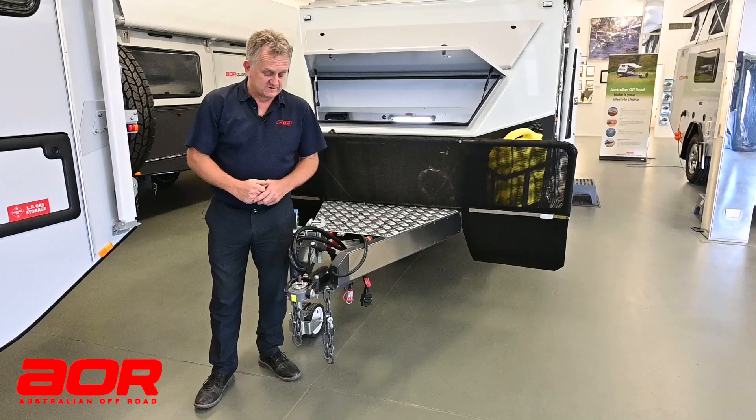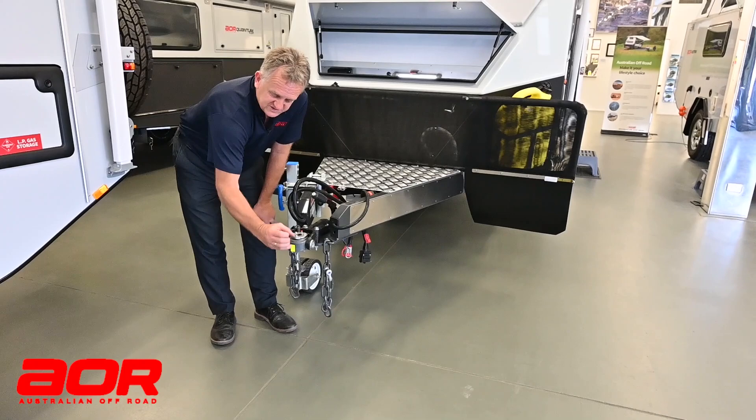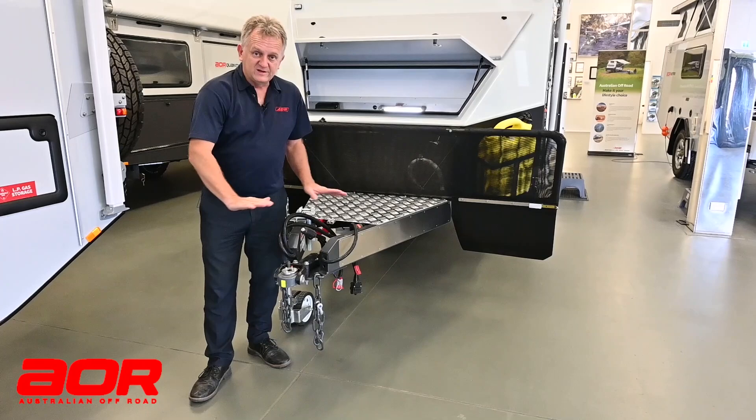We'll give you a quick heads up on our DO35, the hitch and that side of things. The critical point for all of us is around the height we need to aim at. We need to aim from the ground to the underside of our hitch, to the top of our tongue on our vehicle — where our tow ball is normally located. That height needs to be around 500mm. We don't want it at 550mm or 420mm. It's either too high or too low. It's got to be level at that height.